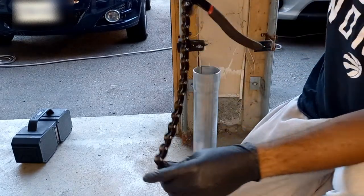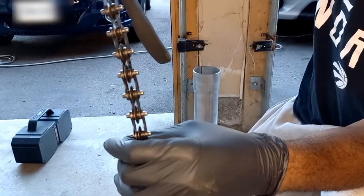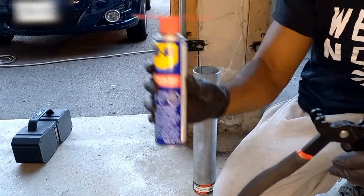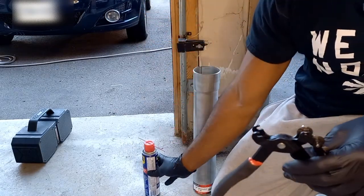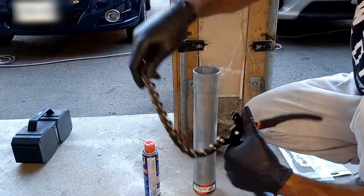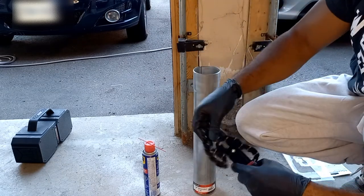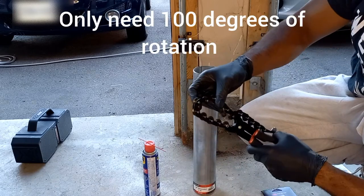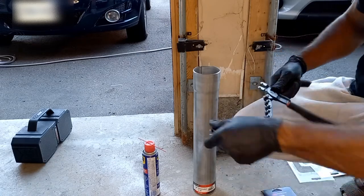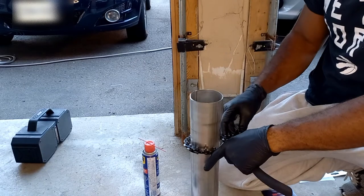So as we see, they're a bunch of wheels that are pretty sharp. And what you would do before you use this, they do recommend using some sort of lubrication. So WD-40 is adequate. So what you would do, go around the pipe and you wrap it around until you find the correct notch. Hold it down tight and then you work your way. I believe it's at least 180 degrees. You don't wanna crush the pipe if you grab it too hard. You kinda do just wanna let the pipe cutter do the work itself.